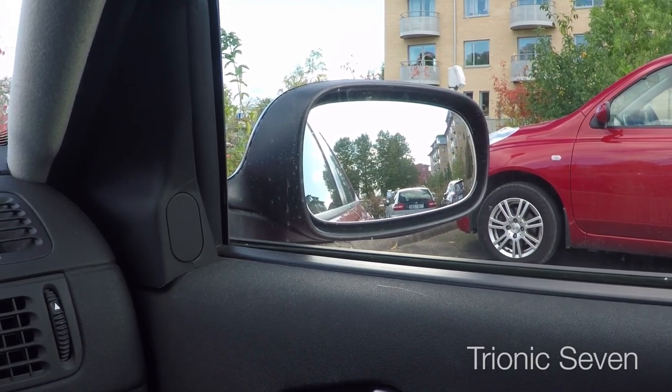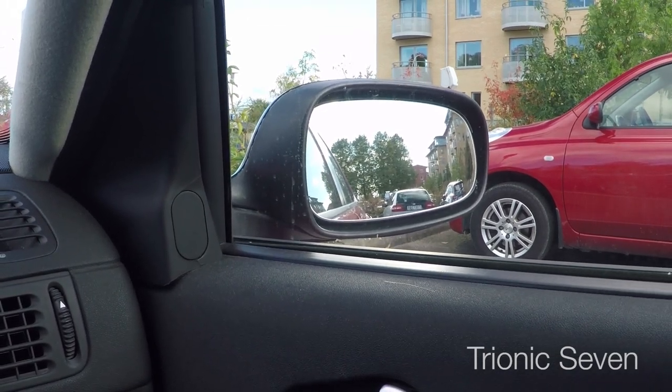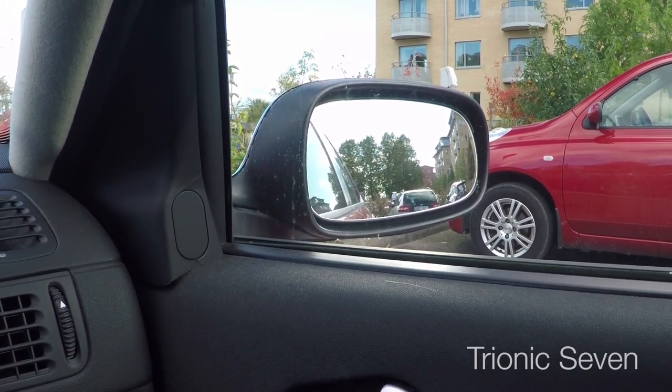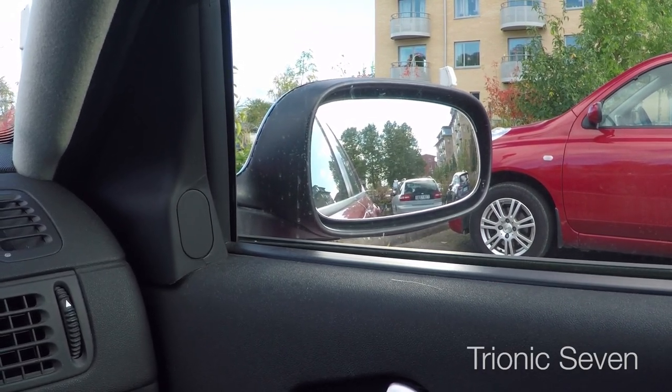Not that the mirror is broken, but that I didn't find it when purchasing the car. I did check the manual mirror adjustment and found that the electrical mirrors are working. However, I did not test the memory restore function and therefore I had no idea that it was broken. Luckily though, diagnosing the problem was very easy when I borrowed the Tech 2 diagnostic tool.